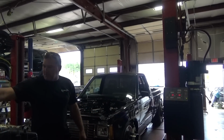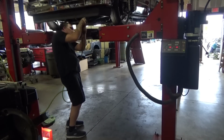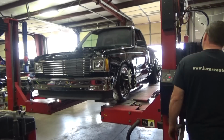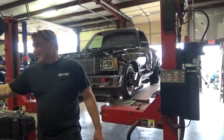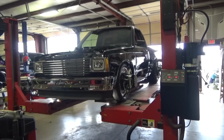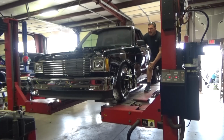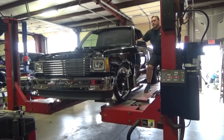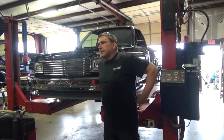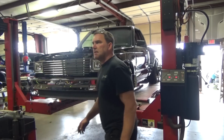Those headers do not make my job easy to do shims. Well, that's a little bit better. I'm going to need a little more camber than that. I'm going to recomp to make sure that I've got repeatable results. But I'm still considerably off. That changed a lot. Let's lean it in quite a bit more.